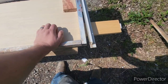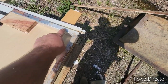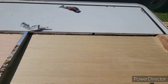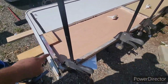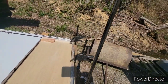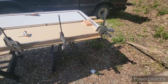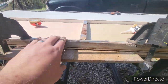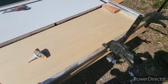Once this piece is in I'll fill in again with more glue underneath so it's metal to wood, same thing all the way across — plenty of adhesion so it doesn't come loose. I glued all around the seams on all sides, put plenty of glue in the middle and down that seam, then put clamps on it with a lot of liquid nail. I'm also going to go back and fill in all these gaps with sealant that also has glue properties, trying to keep any vapor areas or air pockets out as much as possible. Then I'll cut the next piece — three-quarter inch plywood — to go inside while this dries.